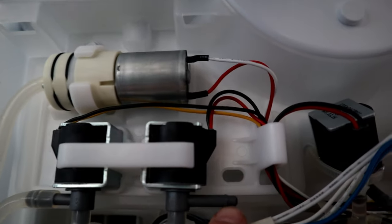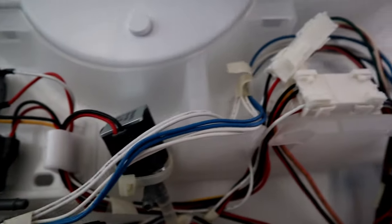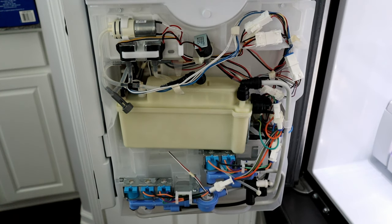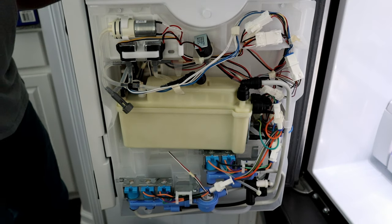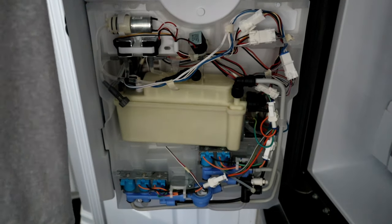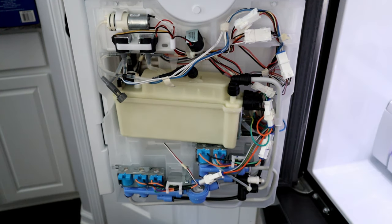These are the relief valves I was talking about — right here, this one and this one. There are two of those and typically water overshoots out those as well. Let me show you from the backside what happens when I press the start heating button. I'm going to try to capture the water. I'll have to hold down the door switch up here too so I can trick it into believing the door is closed. You can see it coming out the relief valves there — it just spurts out.